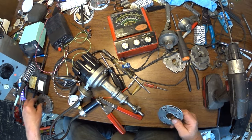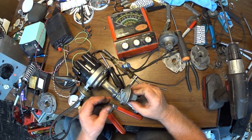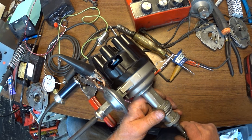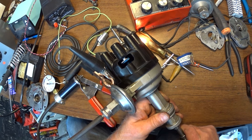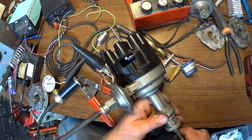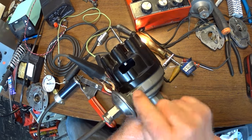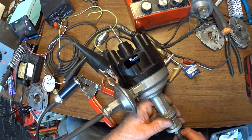So I just exchanged the plus four plate for the plus two. I took the vacuum advance that was way too long, welded up the hole and drilled it shorter. Let's take a look-see at that. Okay, so this is without vacuum advance. It is hitting, bink, right there. See that on that first third of the rotor. And then it turns off the coil discharge right there when the extension is leaving the lug. So at that point, there'll always be rotor pointed at a lug during discharge. Not a big deal when you're doing low RPM. It's really a big deal when you're turning high RPM.